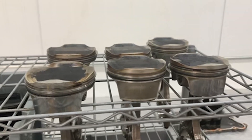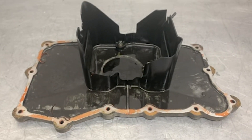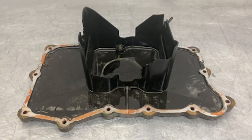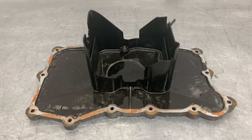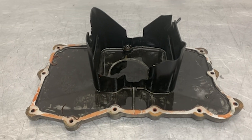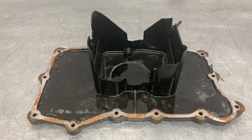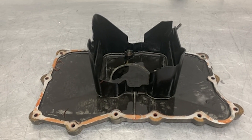What I really want to show you as the moral of this story is the engine oil sump plate. As I tell people, do not bother doing a bore scope inspection through your spark plug holes — only go through the sump so you get the full experience of what you're actually going to see for cylinder wear, because the pistons cover it up otherwise.